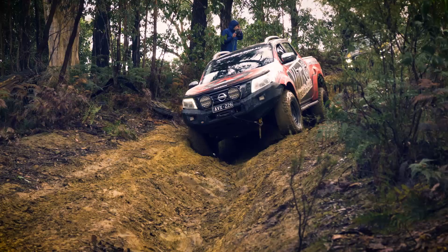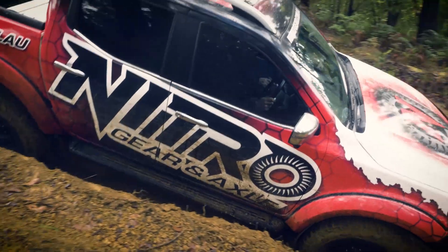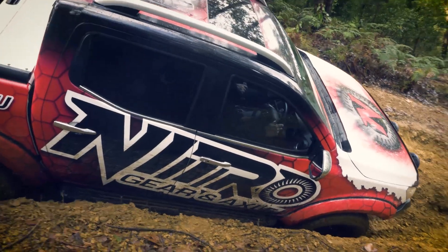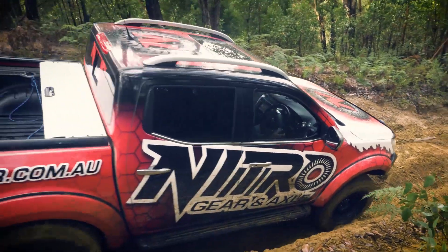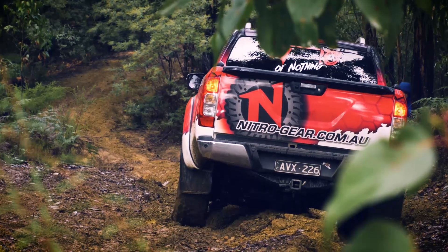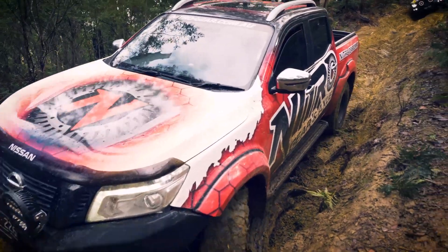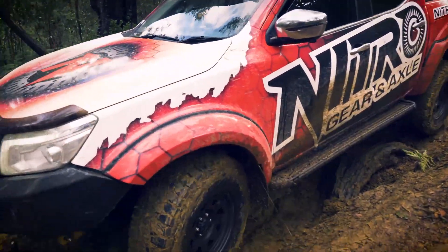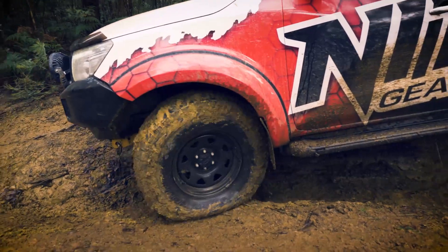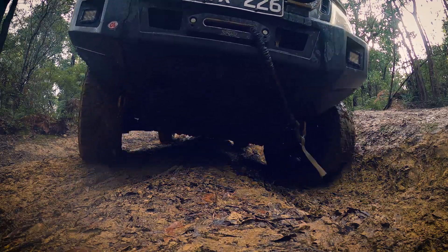Basically, changing the gear sets will extend each gear, so it'll make it a little bit easier when you're towing a vehicle or doing a hill climb. When you change the gear ratios and put a shorter ratio — which is a higher number — it will help with the pick-up and take-off when you're towing, or when you're starting at the bottom of a hill and wanting maximum grip. And it keeps the ratio low so that you can crawl up hills. Definitely worthwhile doing.